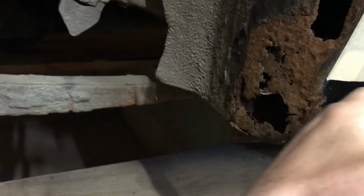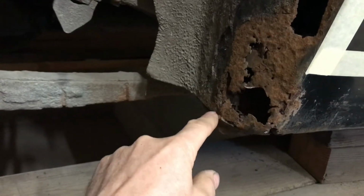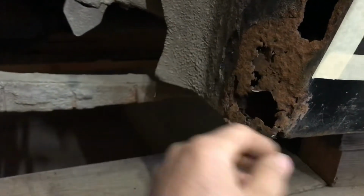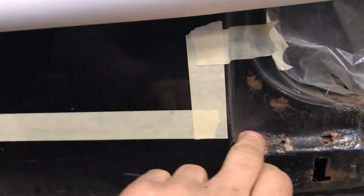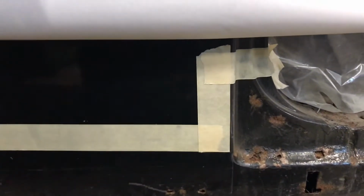So I'll probably, where this bend is here, make a cut in the sheet, remove a piece like a pie shape, and then fold that up to meet this again, and weld it along here. But on this side, I want to try to form this step here. So I just want to do a little exercise here with this piece of paper.